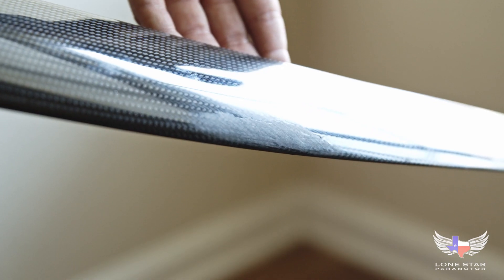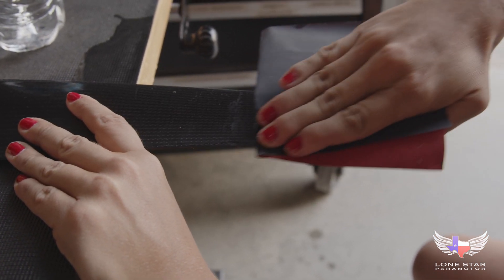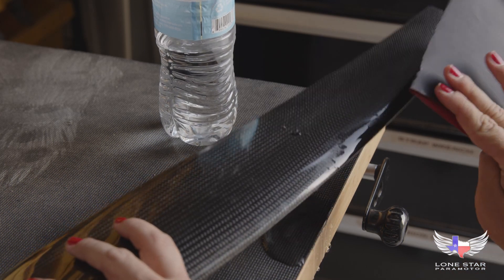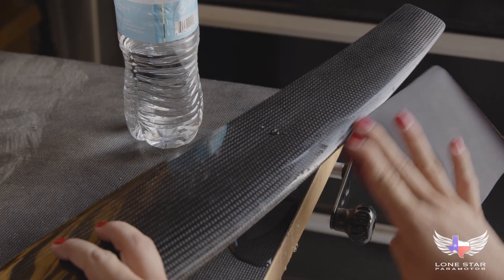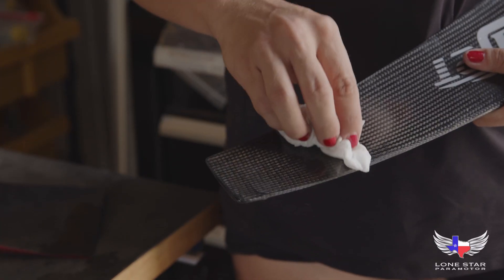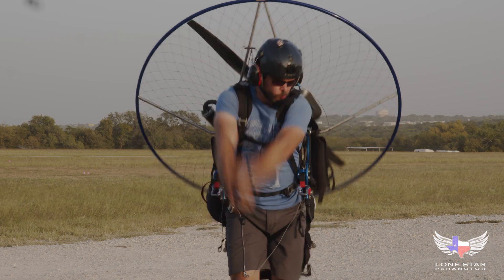After the prop shape is intact, switch to the wet sandpaper to polish the repair. We use 1200 grit — the water helps keep the area clear of carbon dust to give you a nicer finish. You can also use a polishing compound. This looks good to us.